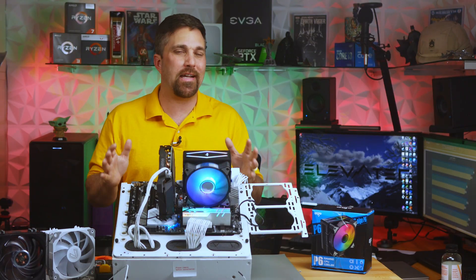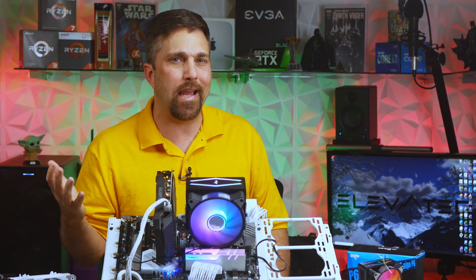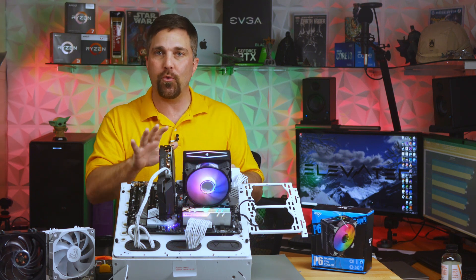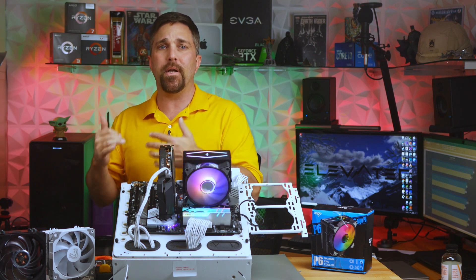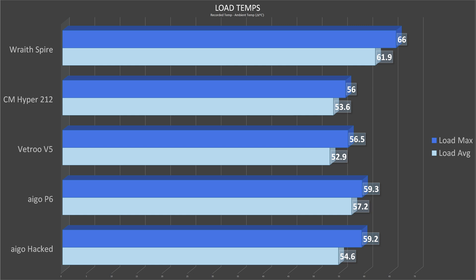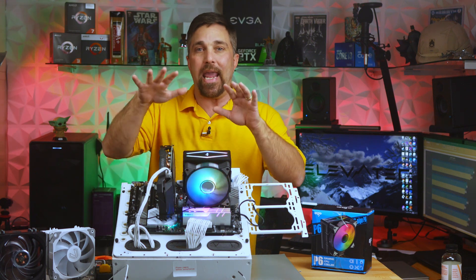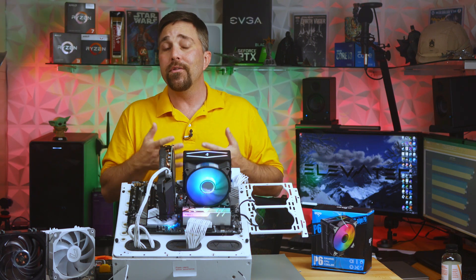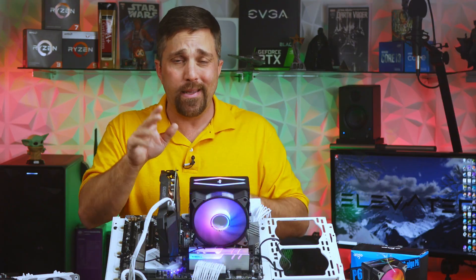That initial run was actually a bit of a fluke — not a fluke, just me being forgetful. The test runs for 20 minutes, not 10, so temps did creep up some more. I did the full benchmark: three 20-minute runs, reinstalling the cooler three times in between for a total of nine runs. In the end, the mod knocked 2.6 degrees off the average load temp, bringing the Ego within a single degree of the Hyper 212 and closing the gap with the Vetro to 1.7 degrees. However, the max peak temp remained the same. I'm not advising you to go hacking up your CPU coolers — the CPU did eventually hit the same 59 degrees above ambient, it just took a bit longer. Besides, if you nick a heat pipe, say bye-bye to your cooler.